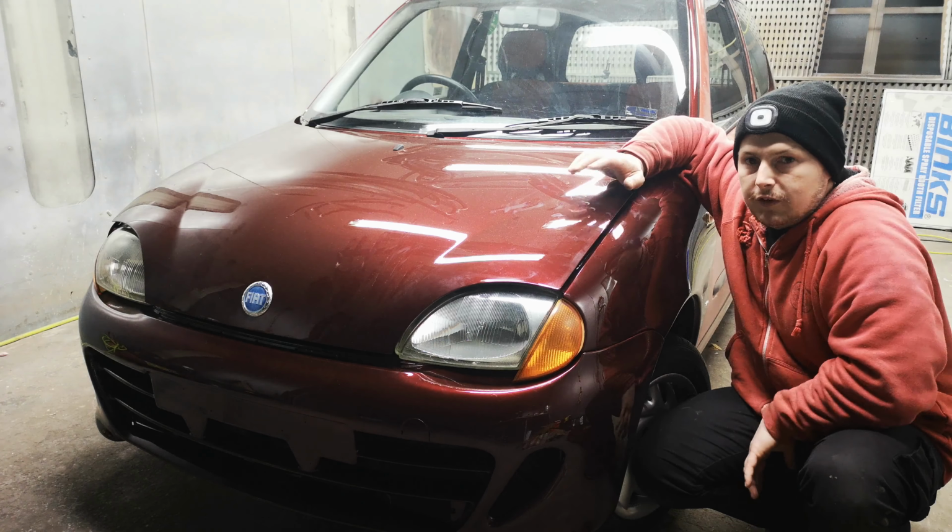Now everything is sprayed. The only thing is, I won't be buffing or polishing anything now. The paint has to cure. I'll leave it for a week or so because it's still fresh and will still be evaporating. That's what it says on the label. Quote me, but the guys producing the paint do it every day, so they know what they're saying.